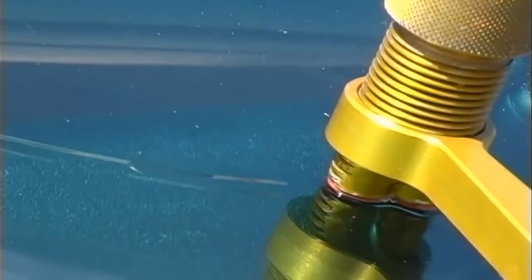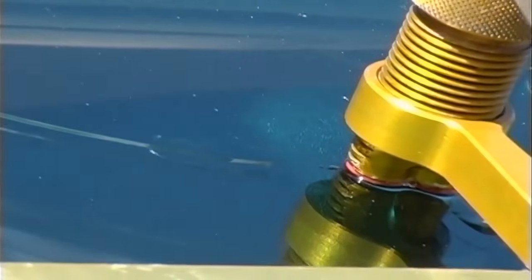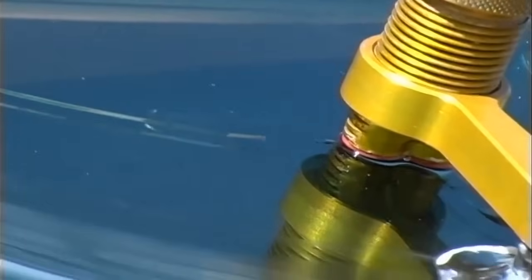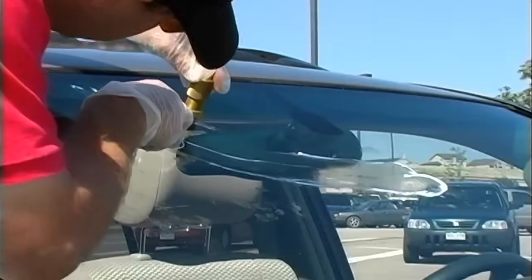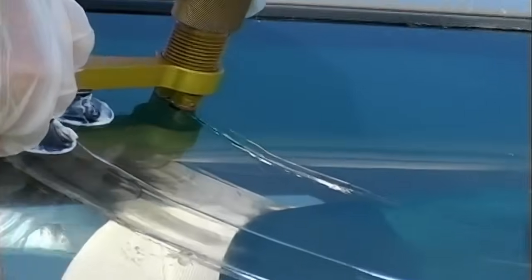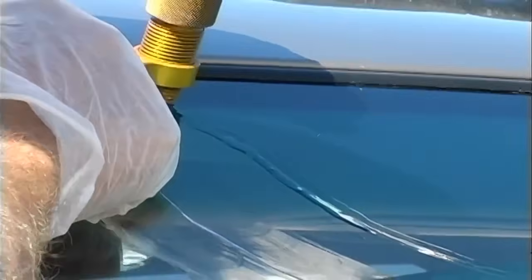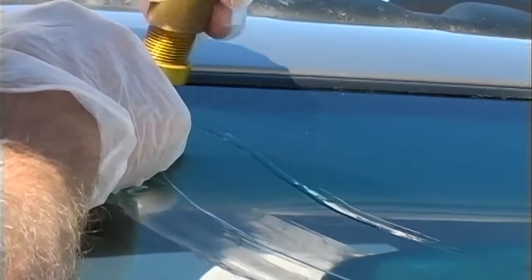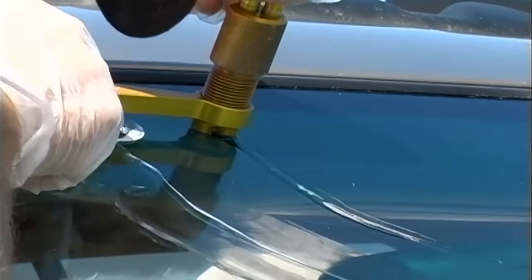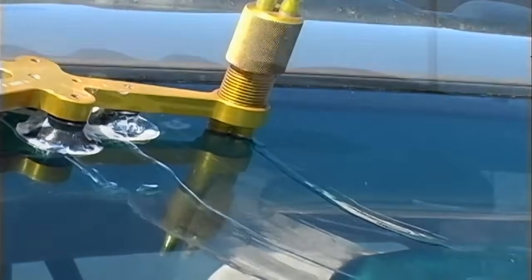You will want to keep the crack out of the sun until you get good at it. A lot of times I'll repair right out in the sun because I'm pretty confident, and I wanted you to be able to see on the video — if I started to shade this repair, you wouldn't be able to tell what's going on. But if you're good enough, you can repair right out in the sun. We're just going to finish following the crack right up to the edge, making sure you're getting resin from both barrels. It's going to start leaking out because the crack is gappy at the edge. Run all the way up to the edge and then come back to the impact point to leave the resin under pressure on it a little bit to make sure it feels good.